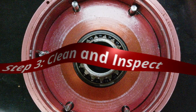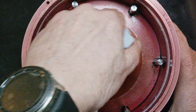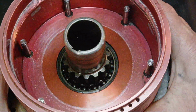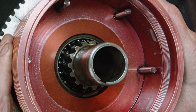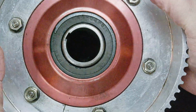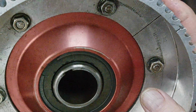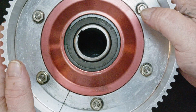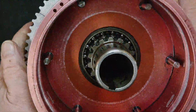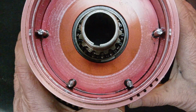Okay, the next thing you'll want to make sure you got done is cleaning it out. It's pretty good, and then you got to inspect it. So, that look good? And you want to look at the seal on this side. If it shows any divots or bad wear marks, you'll want to replace it. But I find that the least aggravation you apply to these things, the longer they last. I think I put that one in there for Daytona 2022, and I haven't run a clutch since.